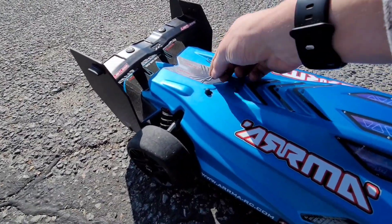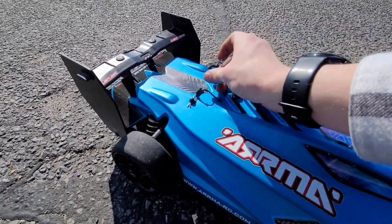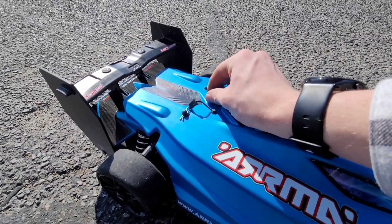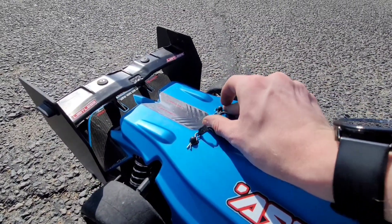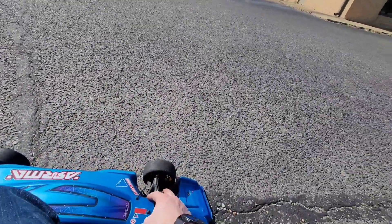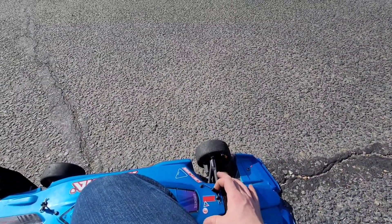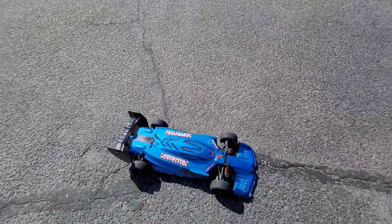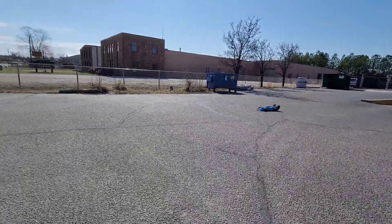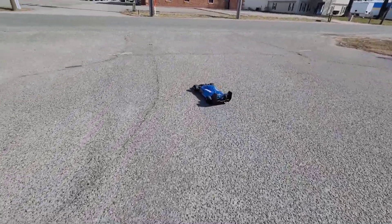What I was saying before was I tried something. I'm just testing something — I didn't change a gear or anything. I was testing something that I changed in the settings, because the motor was so hot when I touched it. I don't have a different gear — I have one gear and then a gear a couple teeth away. So I was seeing if I turned down the motor timing to do something. It seems to be fine now.